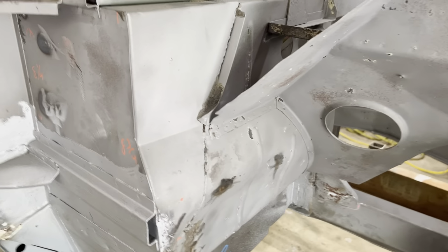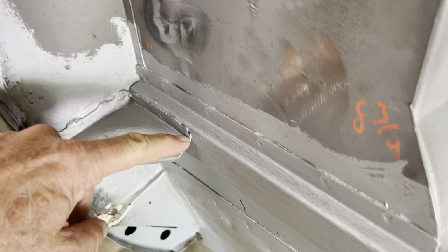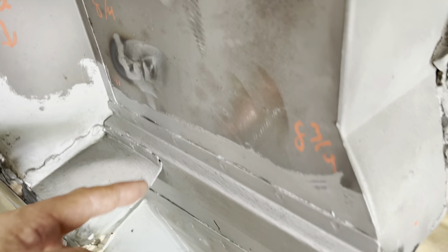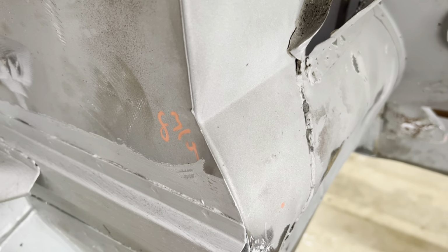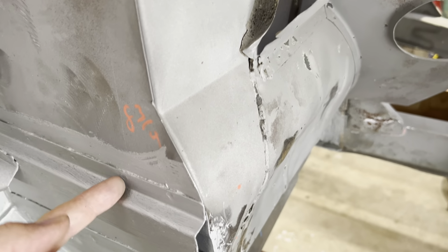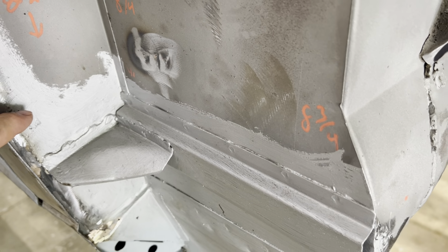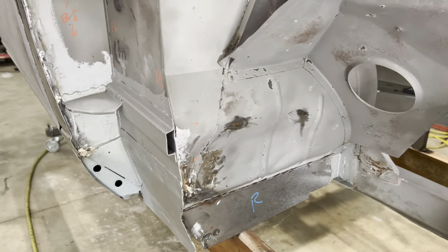Today, in doing quality work, everything that's been made, all these pieces are all the twins of those pieces you see right there. Each one of these has been sprayed with a weldable coating on the surface that welds, and that way, even though we're welding these at high temperature, they are primed with a protective coating which survives being welded through. And then the finished structure is further coated with this silver coat that you see on top. And that means that there is no bare metal surface anywhere to rust.